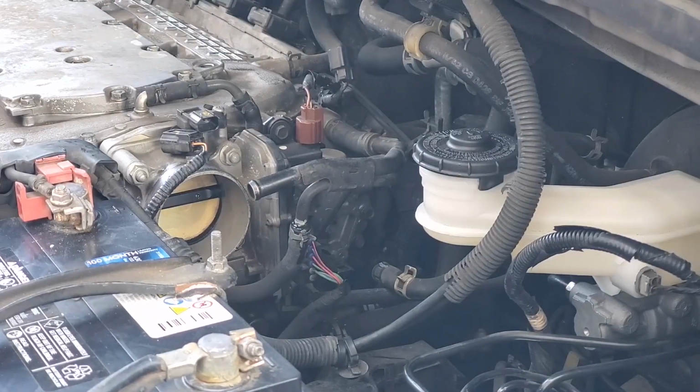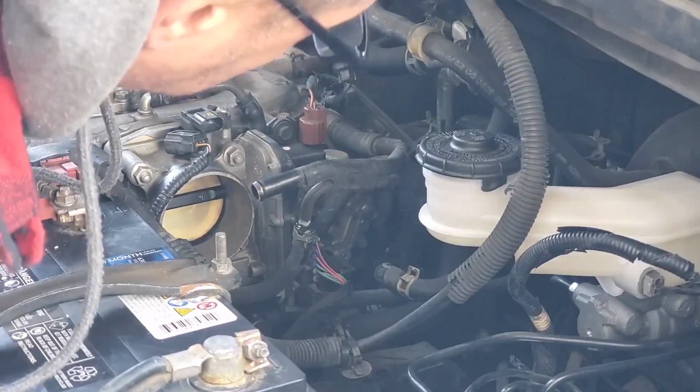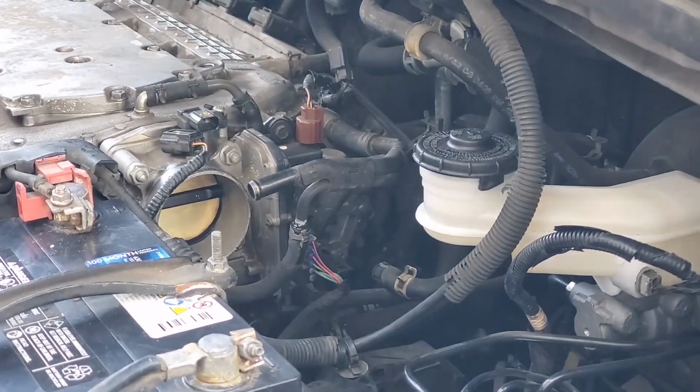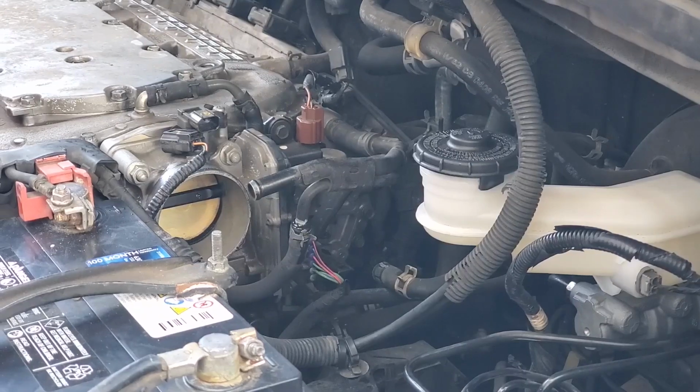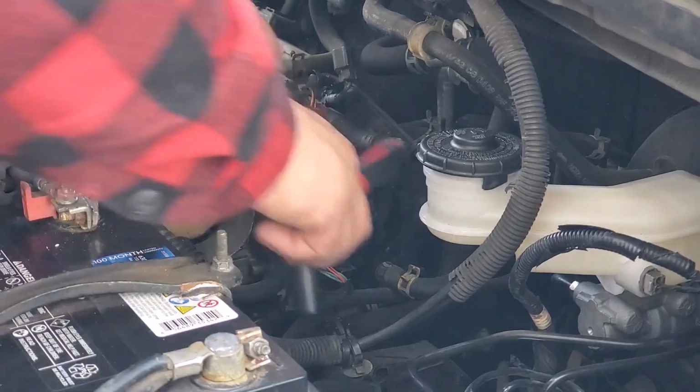Some paraffin base oil. No, I'm not a fan of paraffin base oil. It's good if you use it once, you race with it, it's wonderful, but you better change it. Run behind it with detergent oil to clean the engine, then use it again. That's just my personal opinion.